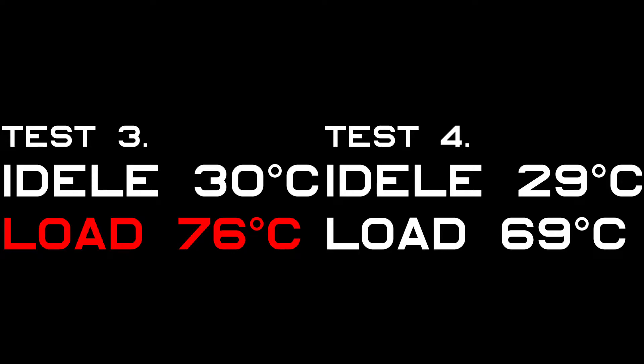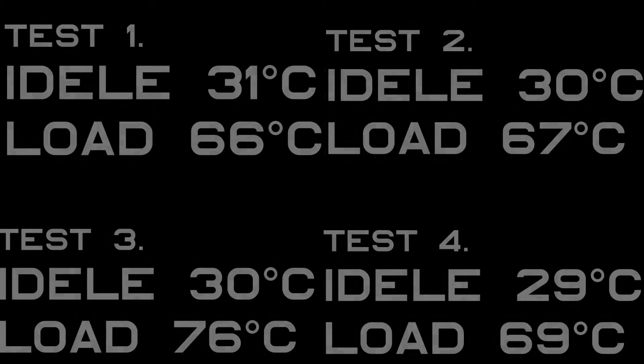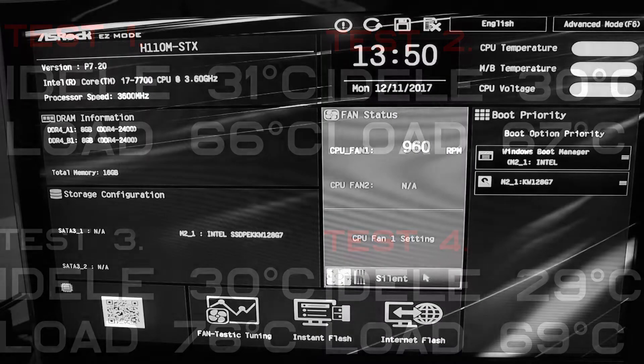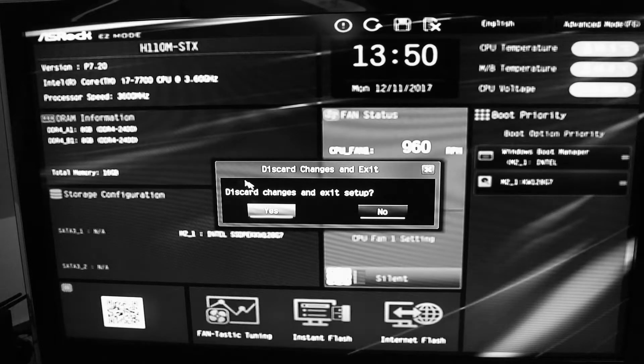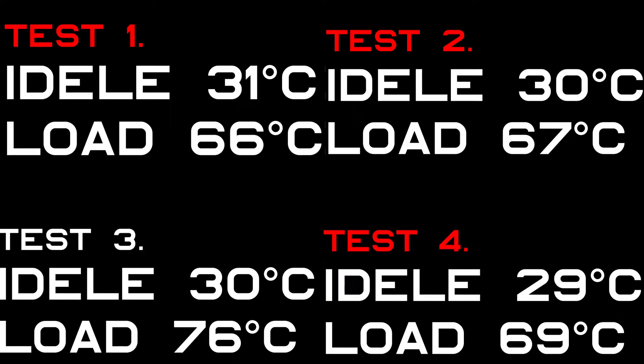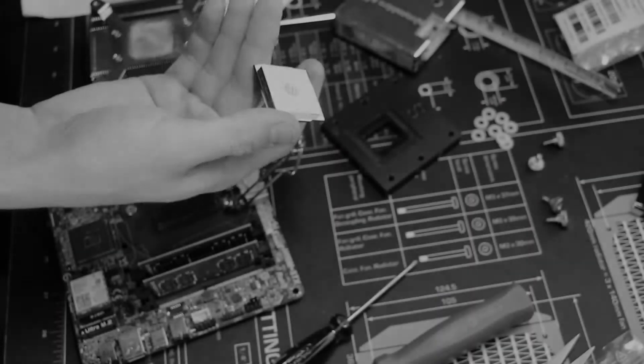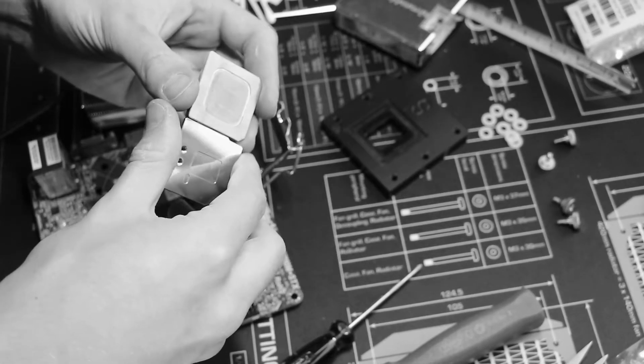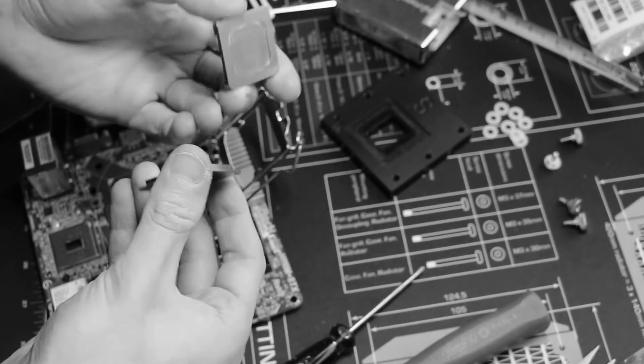Instead, the heat rises inside the CPU because it doesn't have the potential to get rid of it. If you look at all four results, you can clearly see that tests 1, 2, and 4 are literally the same results, just with slightly different temperatures. As temperatures are very easily affected by ambient temperature, I can suspect that they are essentially equal — I tried to stay as similar in ambient temperature as possible. You don't have to look at them like there's 1 degree more or less with one or another — it's literally the same results. The idle results are within 1 or 2 degrees and the load temperatures are within 1 or 2 degrees. So the different IHS's are performing all equal. My assumption would be that temperature is highly influenced by the thickness of the IHS: if it is thicker, temperatures stay inside and behind the IHS; if the IHS is thin enough, it can dissipate the heat better to the cooler.